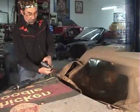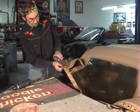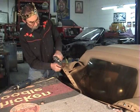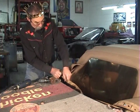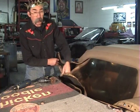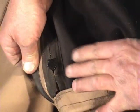For the main rivets, I use a die grinder with a cut-off wheel and cut the head off the rivet — it appears to be a brass rivet. I thin out the head of the rivet with the high-speed grinder, give it a chance to cool off, and once it's thin enough I just pull it off. Once the rivet is undone, I do the other side, then work on removing the zipper clips that hold the zipper and pull back the main top to expose the back side of the zipper.